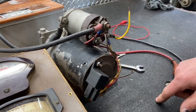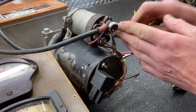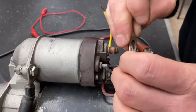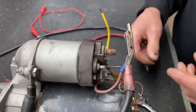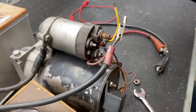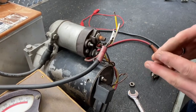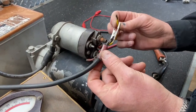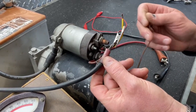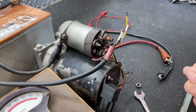Let's unhook this so we can make the solenoid just click. Lots of people have heard this before — when the starter doesn't work but they hear a click. We hear that all the time. Let's simulate that. Without the relay, that's a lot of current. Now with the relay — not nearly the amount of current. Just to show how bad that is, we're going to do an amperage draw test to show what kind of load that is.